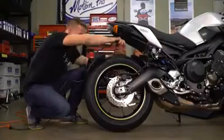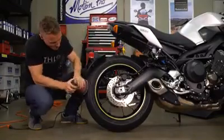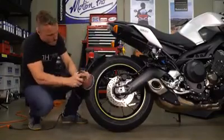Using sandpaper on a set of new tires in an attempt to break them in is something I've heard suggested. And while it's not exactly a bad idea, it is a waste of time. Tires are tough, and that sanding action isn't nearly enough force or friction to roughen up the surface the way riding on it will. Okay, so scrubbing in the tire surface is important for improving grip, but some folks still think that new tires are slick because they're slathered with something slippery from the factory.